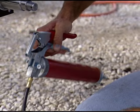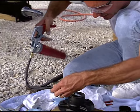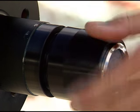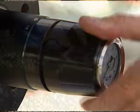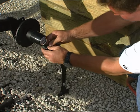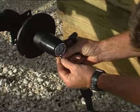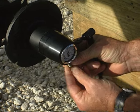We're also going to get into a new accessory that you can add right over top of your hub, where you can pressurize the grease inside. Now, why might you want to do that? Well, it's going to give you an indicator of whether any grease is blowing out from the back side of that seal.